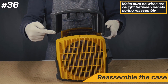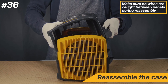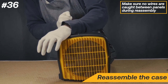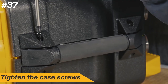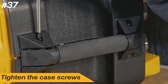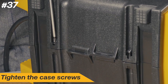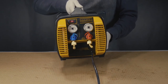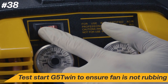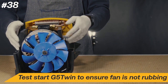Slide the other side panel into position, then firmly hit the bottom and top of the side panel into place. Tighten all of the case screws. Quickly turn the machine on and off once to listen for any possible rubbing from the fan. If the fan is rubbing, it will be necessary to remove the panels and realign the machine and support brackets in the case.